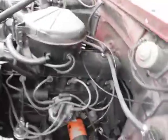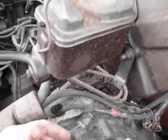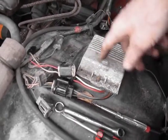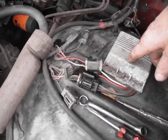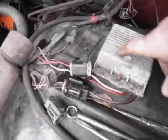I could pull a plug and check number one, but I'm not going to because I have to pull all these plugs and re-gap them anyway. Right now we're looking for a 12-volt keyed ignition source - I believe I found one. I disconnected the ignition control module. This is probably what's going to fail, and this is why I'm doing this also - these fail. This is probably the second or third one; it looks like it's remanufactured. These fail a lot and I don't trust them. The Motorcraft distributor is pretty good - there's a little eyeball in there that does what points should do, and that lasts a pretty good long time. I'm just a little hesitant about this old system.